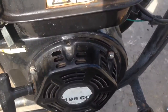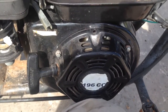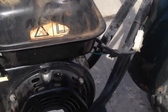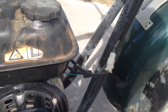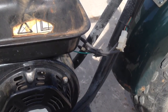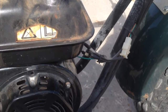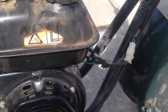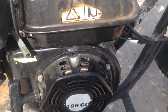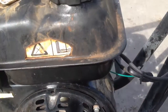What we're doing today on the Baja Mini Bike is we're going to put a rectifier regulator on it. This thing came with a light. The lighting circuit on it right now is AC voltage. My bulb is actually burned out, but I'm going to convert it — it's unregulated AC, so it can go up to however many volts. This thing's not going to put out much, but we still want to keep it regulated. I don't want to be burning stuff out.